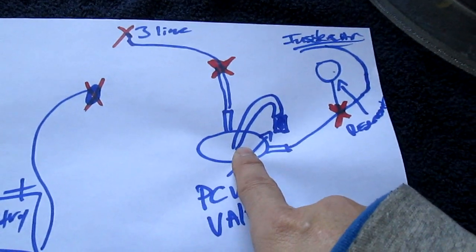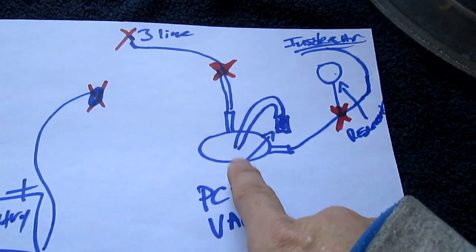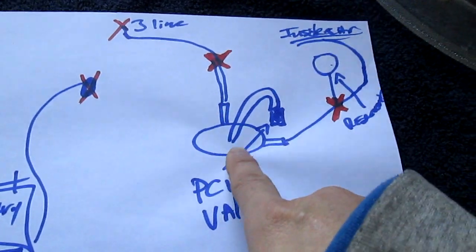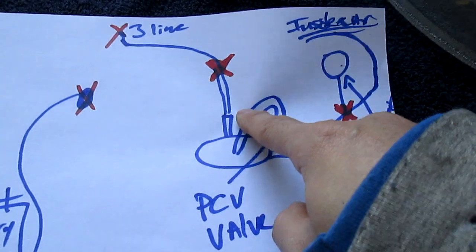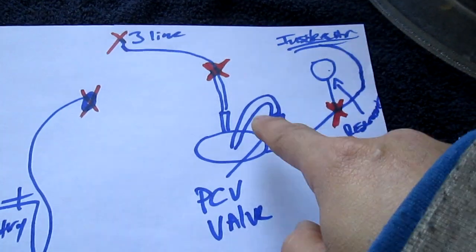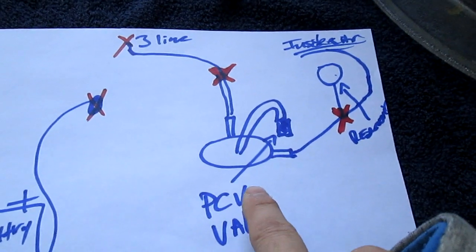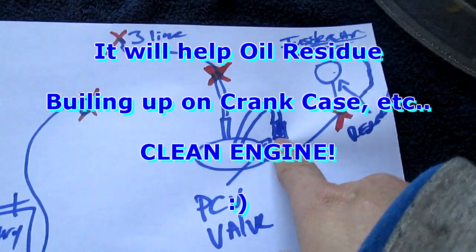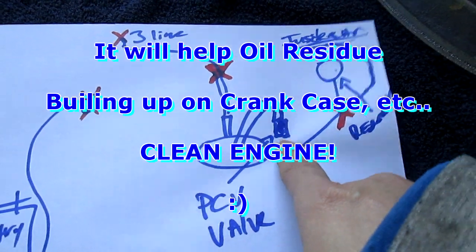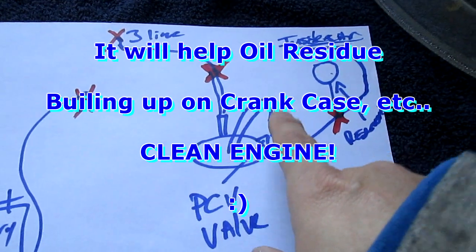How do I know that? I broke it. I made it into three — there were three things coming out, and that is better. And I'll explain to you why: the big one goes to the PCV, and you want the big one to go to the PCV because you want a lot of moisture and vapor to leave the engine. So that's important.